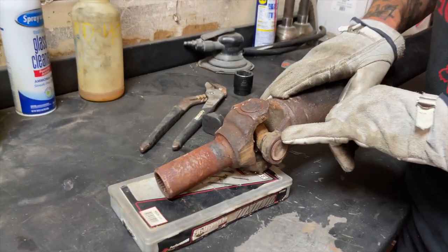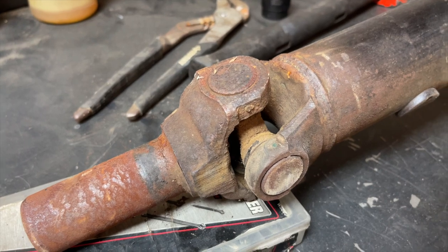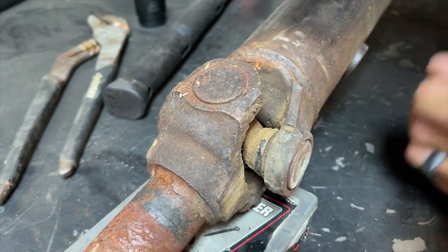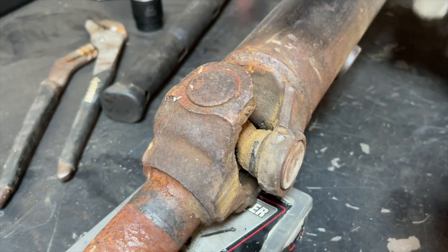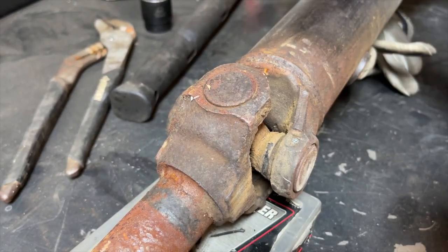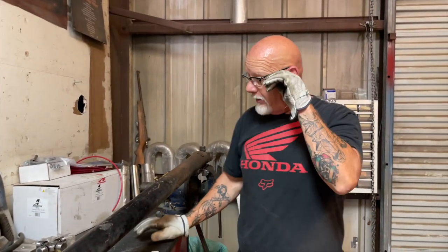What you have to do — if you guys can see — there's a little dot right there, a little ear sticking up almost right off of this tang. That thing right there is a piece of plastic colored silver; that cap is the top of a piece of injected plastic. That piece of plastic rides in the retainer groove on the U-joint. That's how they decided to put these in. It's been theorized that this was an attempt to get people to come back to the dealership. I don't know what the deal is, but I know it's a pain in the ass.